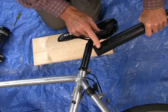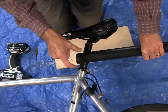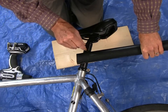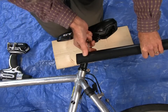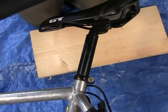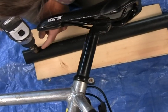Now I have one hole drilled and I'm going to drill the other one. We need to figure out the angle for the second hole. I focus on this edge of the hole and I'm lining that up by eye with the back of the seat post, then looking at the top part of the seat post and lining it up. I'm going to make a mark on the tube where they line up on top — that will be the back part of my hole. The tubes have writing on them, and I generally use the writing on opposite sides to line up the hole. So now I'm going to drill the second hole, lining up this edge with the drill line I drew.